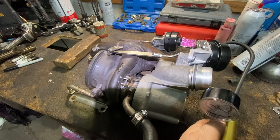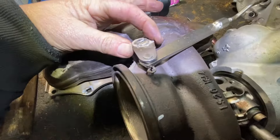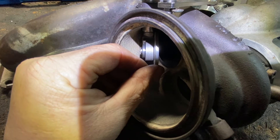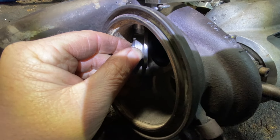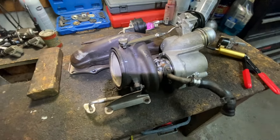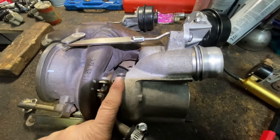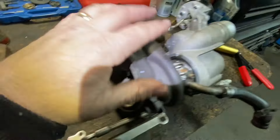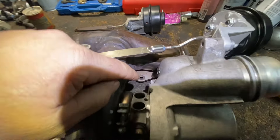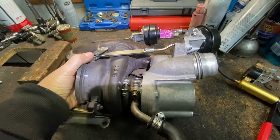Let me let out the vacuum. Before, this really rocked a lot. Now it really doesn't rock — it's really tight in there. There's just very slight movement, not in and out, and the whole thing barely moves. Now if you want, if you have a turbo problem, I have a video on how to replace the turbo cartridge — you just split these two apart and replace it. Once you replace that and fix this, the turbo is new again. You've got a wastegate, a pop-off valve, a diverter valve — other than that it's just a big pipe, so it's really not that complicated.